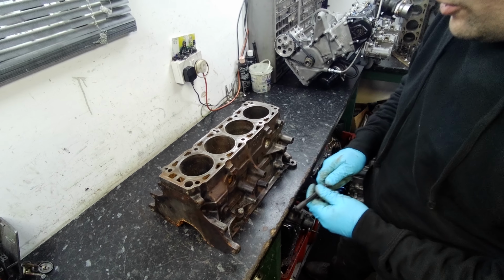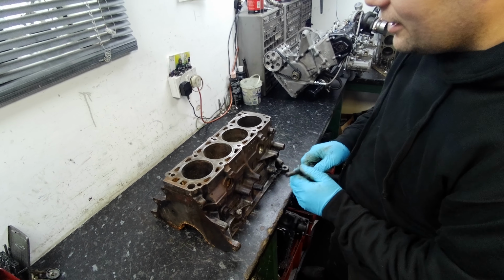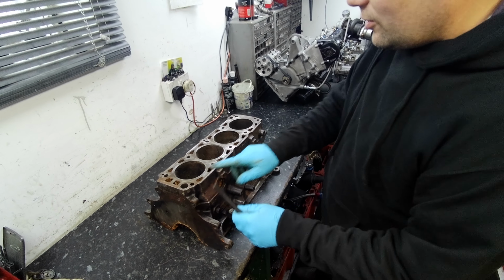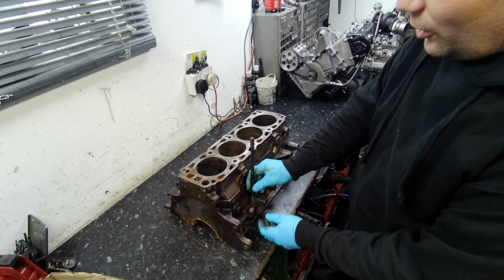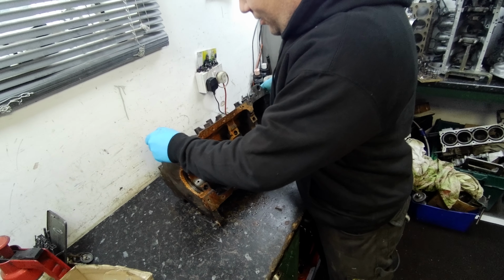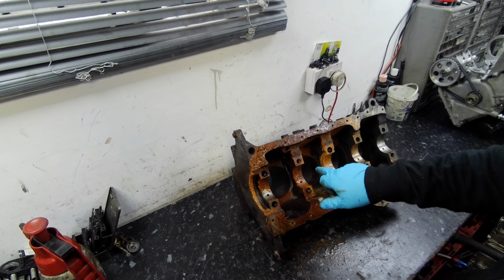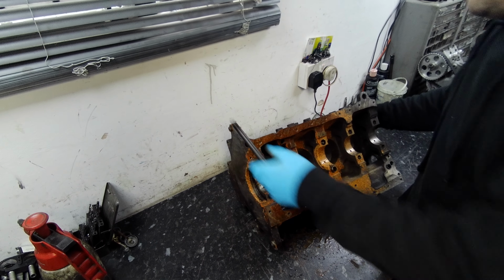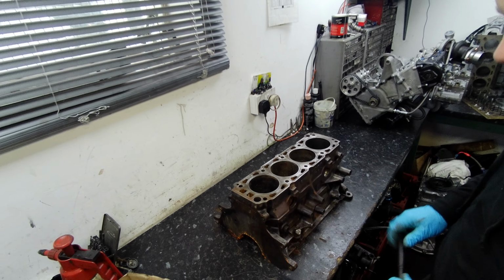It's typical of anything that's turbocharged, where you want really good clamping force on the head gasket. So we pull from down there, and it takes all the stresses out of the surface here. Otherwise you sometimes get a bit of a scissoring effect when you really clamp something down. Because it's pulling from down here, in the main bearing area, which, excuse the state of the block, it's been parts in the workshop near a leak in the roof, there's loads of meat here, so it'll be really good and strong for it to pull from there. So that's that. Now, have you got any questions, John, about anything?